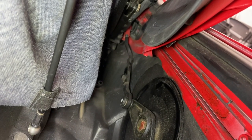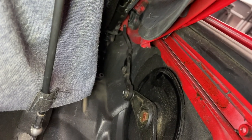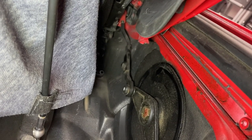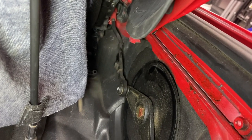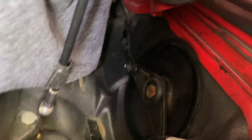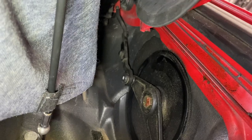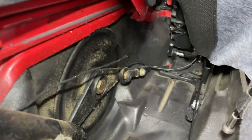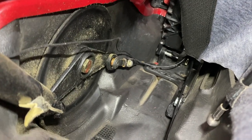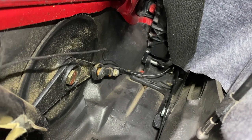For me it's going to be kind of tough to replace that one. Normally you could stick a long screwdriver or some kind of pry bar between the bar and the wall to pop that out of the socket, but with no rod connected to it, it's going to be a little tougher. I'm going to have to pop that off — there's just a little hex bolt down here that's holding it on, so I'm going to go ahead and remove it. This wire running through there is just for my reverse camera, so don't worry if you don't see that on your car. I'm going to remove that bolt and get this bar off.